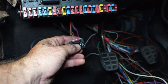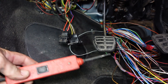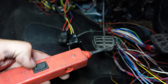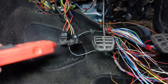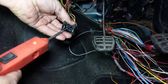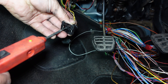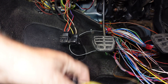I'm going to double check which wire it is and actually put an earth to it, turn the ignition on and make sure the fuel pump primes and comes on first. I'm using a power probe - you can read if there's power as well as send power or send an earth. I'm going to turn the ignition on. It's this yellow and blue wire and that should read 12 volts, which it does. Now if I send a negative pulse the fuel pump should come on. Okay, that works perfectly. So now what I'm going to do is plug these in.